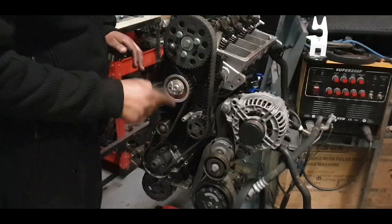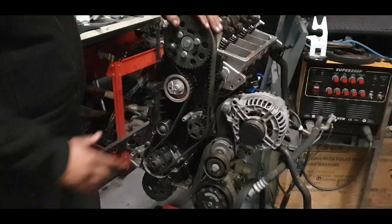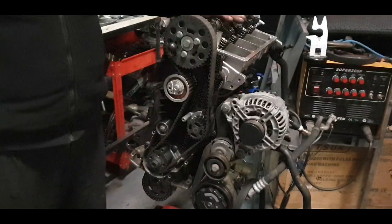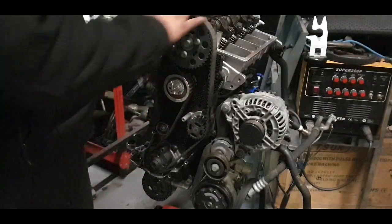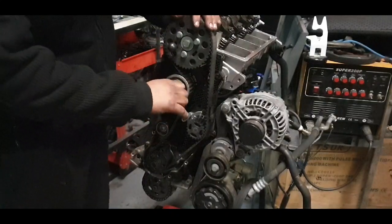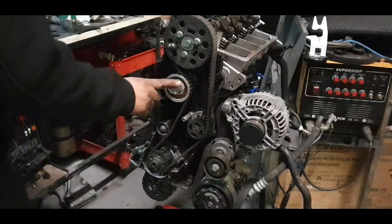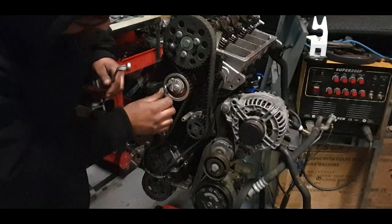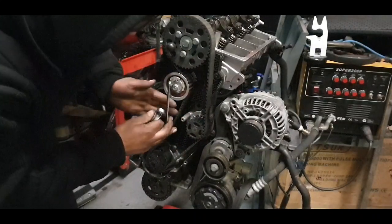This nut is 15mm, this is 13mm. When I'm building a complete engine I like to have the sump off and the camshaft cover or rocker cover off, so I can turn the engine a couple of times and see how everything is moving. Before you tighten these bolts, you need to set the tensioner — you have an arrow that needs to point to the reference arrow from inside.